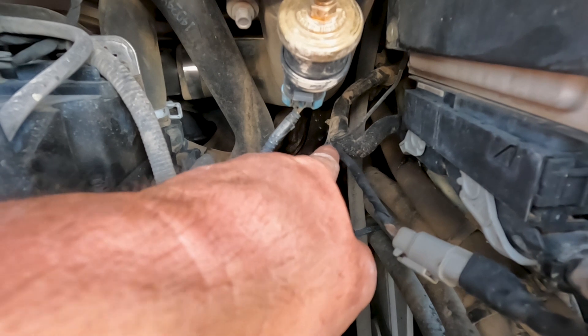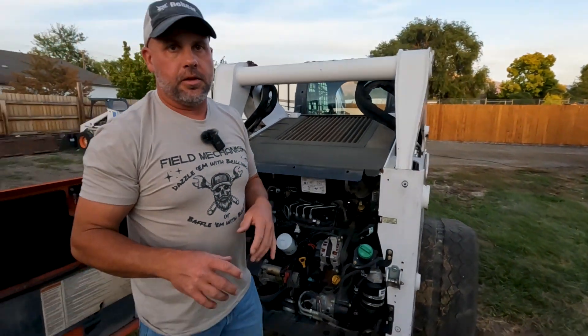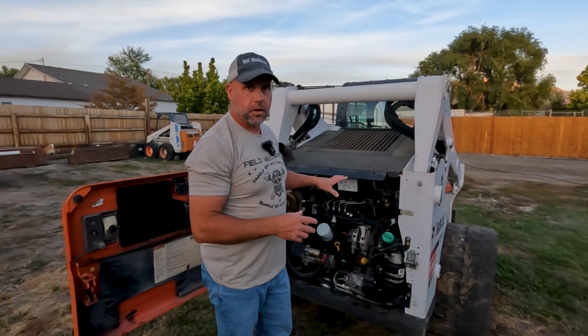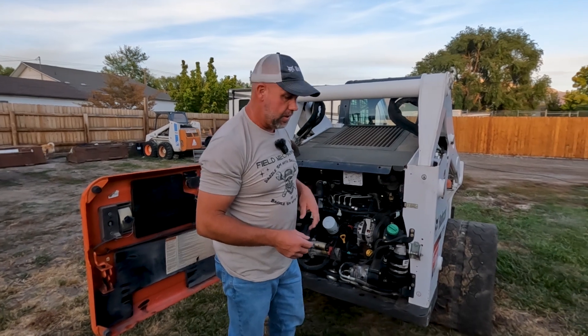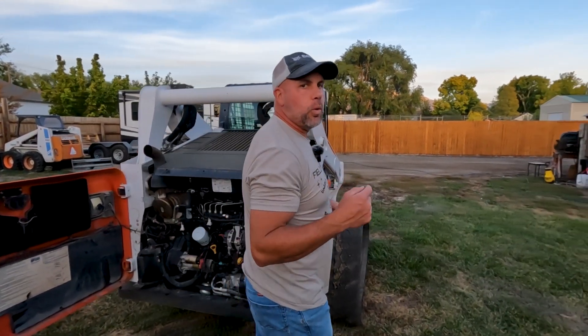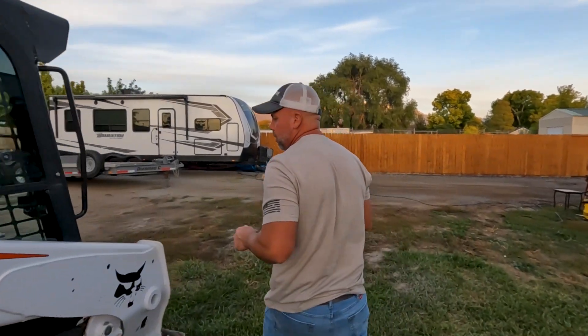There's a little split back here where you can see three or four wires all kind of going into the same harness — that's also a spot where it can break. I've repaired them way back in here before. That gives you an idea of spots to look for on the engine harness that would rub through and cause this IMV fault.